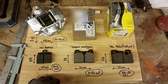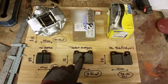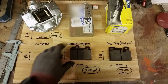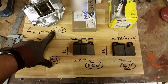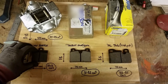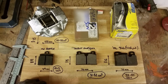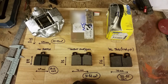What I didn't realise, because it had been such a long time between taking the car off the road - which had stock bug stuff on it - and upgrading it to the Talbots, is how much difference there is between the stock bug and the Talbots. If you look at them side by side, they're slightly over a third bigger - you're going from the biggest stock bug at 20.35 up to 31.82, so it's a full third bigger foot size on the pad. And what I didn't realise until tonight is that the Talbots and the 944 are practically identical.